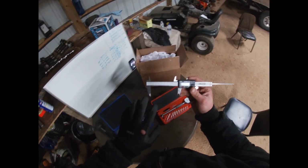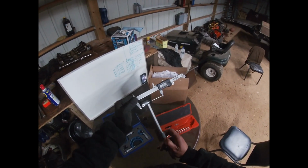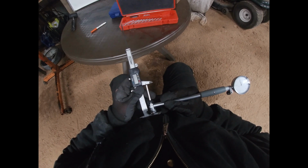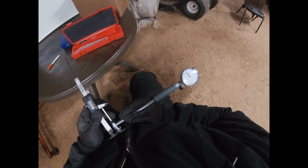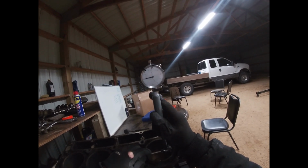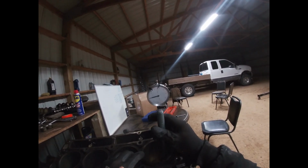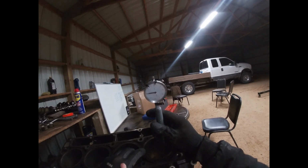You can see I got two little marks on my caliper, and when it's actually closed, those cross. So that gives us a good indication of where to stick our dial bore gauge. It's showing 1 thou shy. Kind of weird. And that's showing just about the exact same thing. So they're both saying 3.779. Seven, nine.